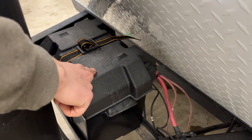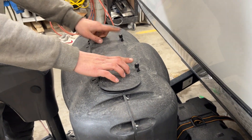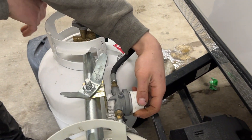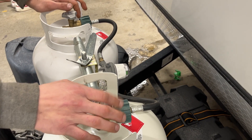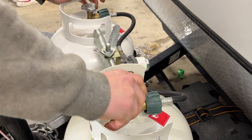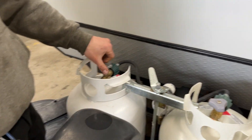The battery is housed inside this box here. As long as you're plugged into that shore cord in the back or your seven-pin to your tow vehicle, that battery is charging for you. Those two knobs you can loosen off, push them back, and open up that flap to get access to your propane tanks. There's a little arrow indicator — currently red, letting us know there's no propane in the system. As you open a tank up, you'll see it goes green. If it were to go red while a tank is open, it's just letting you know that tank's empty — close that off, put the changeover to the other side, and run off that tank while you get the other one filled.